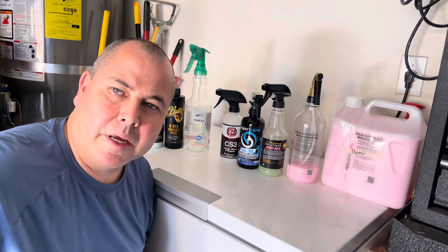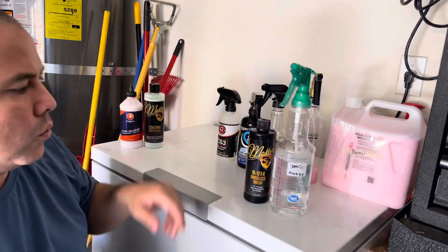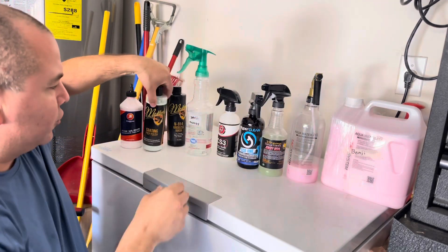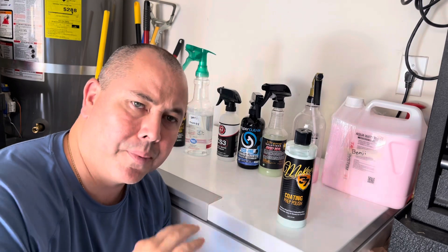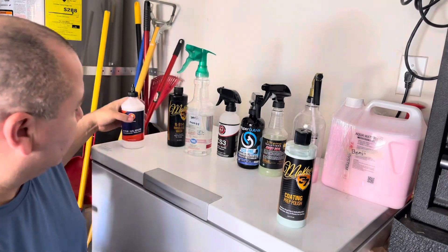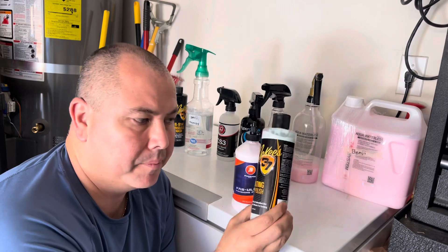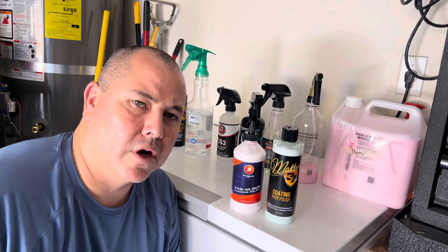To clean the glass — I think I've put CanCoat on there from Geon — I'm going to do a quick wash with McKees N914 waterless wash to clean the back panel and glass. Once that's clean, I'll use a coating prep polish and a flex cordless polisher to polish that window down. If the coating prep polish doesn't remove the coating, I'll come in with the Phoenix Fabulous Finishing Polish as my more powerful cutting step. Let's get to it — hit that like and subscribe button.